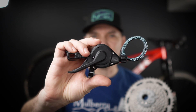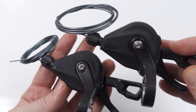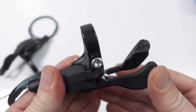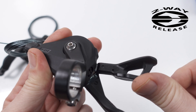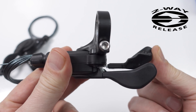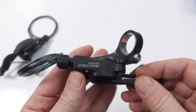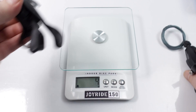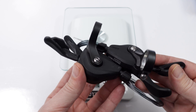What about the shifter? How is this any different from the 5100 shifter? I have the 4100 on the left and the 5100 on the right — and you can't really tell, because these two shifters are absolutely identical. Interestingly, both are manufactured in Japan. They provide three maximum gear shifts for downshifts; upshifts are one at a time, and you can do two-way release by either pushing or pulling on the lever. Shimano has them available with a bar clamp or with an i-Spec EV adapter. The 4100 also exists with a gear indicator. Weight of the 10-speed shifter is 138 grams — pretty much the same as the 135 grams of the 5100. Same technology, same weight, same shifters — different number of clicks.